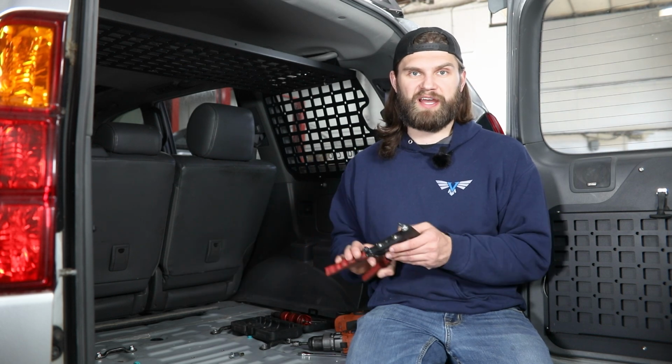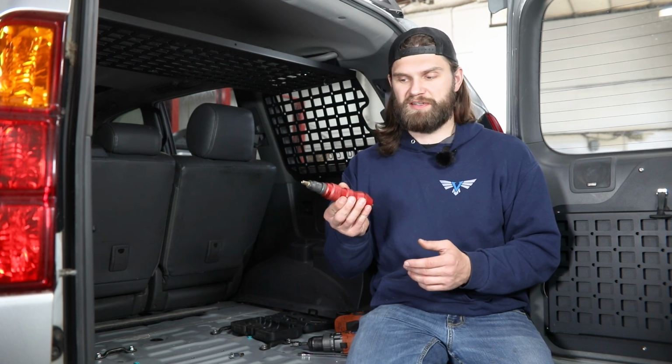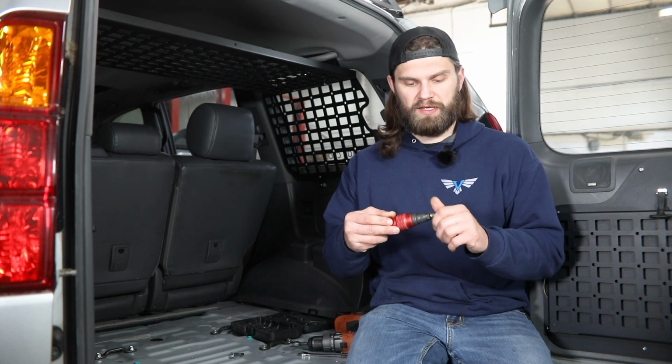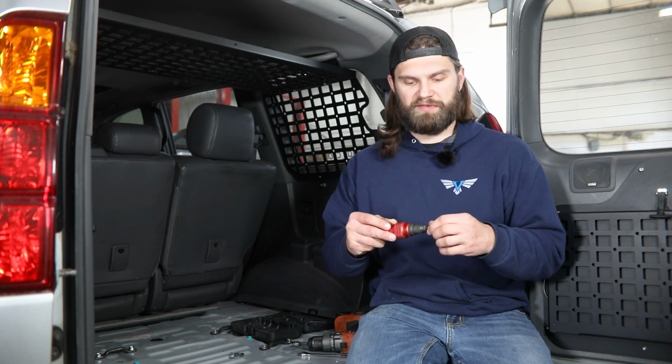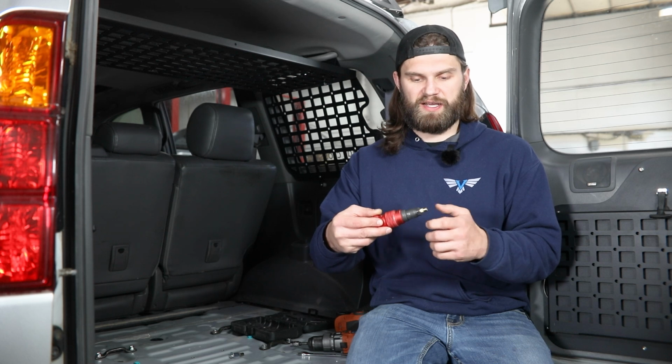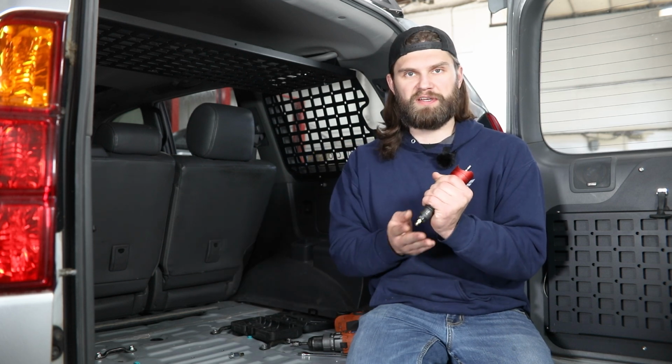So one I wanted to mention is just this kind of hand riveter style. If you've ever put in any pop rivets with something like this, you simply thread the riv nut on the end here. There's a little bit of adjustment that has to be made, but obviously they'll have instructions, and then squeeze it to get them installed. And then the other, which we really like that we have here, is something like this. It's got a lot of different inserts for the ends, so you can use a lot of different styles and threads of riv nuts. Obviously we're already set up for M6, so basically you just thread it on the end, make sure you have good thread engagement, and then this other end is powered by a drill. So it's just hold the tool, run the drill until you feel it basically stop down here once inserted, and you're good to go.